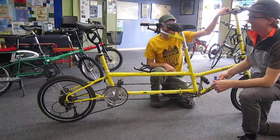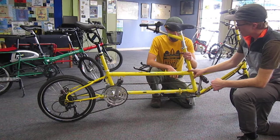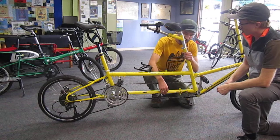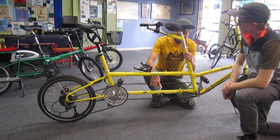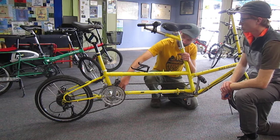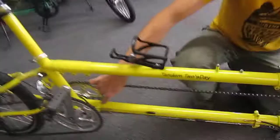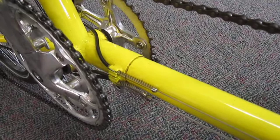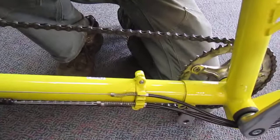That's the basics — that's how it should work. Just for some clarifying points: the tubes on the bottom and the top should be fully butted into place. So that's why I said originally, if we're starting off with a bike that's working well, this will do it. But if you're starting off with a bike where the shifting or braking is out of whack, usually the situation is that the other end — the end we did not adjust — is not fully inserted into that socket. If I'm looking at a run of exposed cable that bridges over where this tube inserts into that tube, I always want to make sure that the mid-tube is inserted as far as possible into the socket of the rear section of the bike. That's the section we don't ever want to move when we're tensioning the chain.